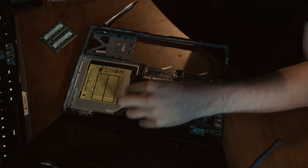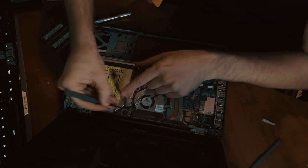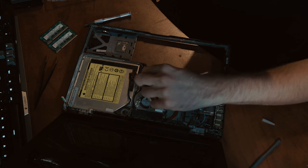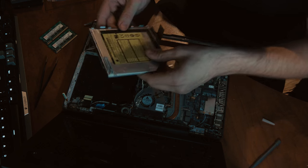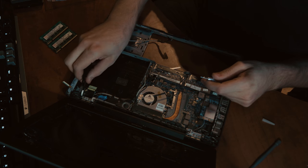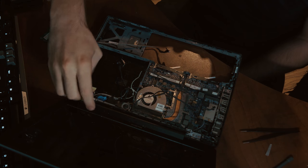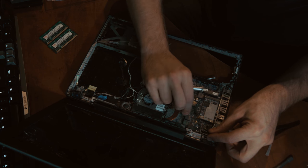Pull that up. With the optical drive out of the way, we can take these screws out by the speaker — one is very small and one a little bigger. Next we want to remove the light sensor. This cable here should allow us to lift the optical drive out. We have the optical drive out. With that screw out we should be able to remove the speaker. We want to remove the microphone, the speakers, the right speaker and the subwoofer. We can take this screw out and then remove the antenna. There's this little piece of foam — save that.